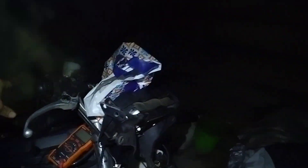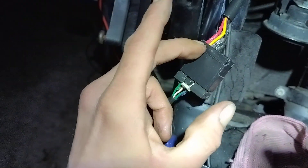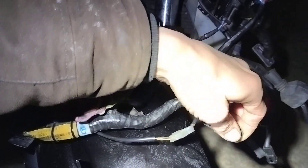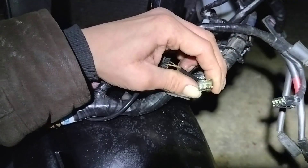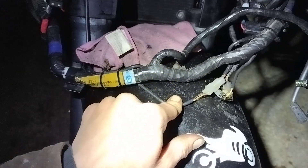Here's a quick update on where we are. I managed to do the starter switch side — some of these come out really bad, just green inside and caked. His heated handle grips weren't working — these little switches here — and inside one of them it was just an absolute caked-up mess. No wonder it wasn't working. The last connector I cleaned was completely bad — even the positive line had no way of making contact. This is why doing these jobs is very important.